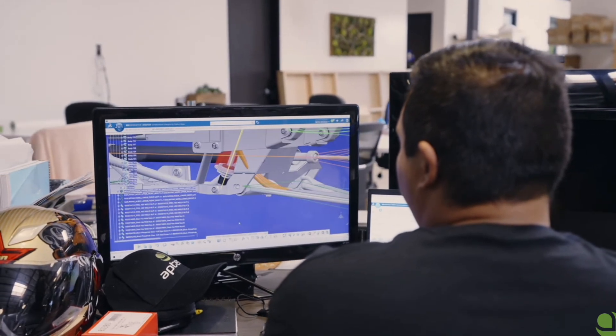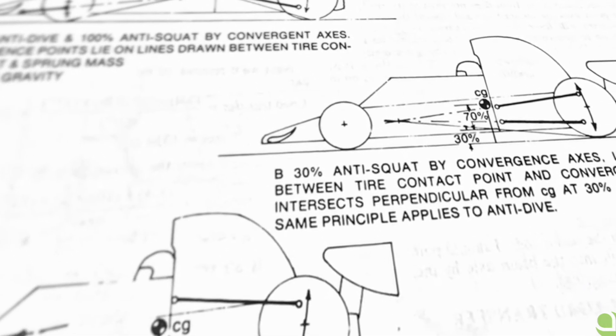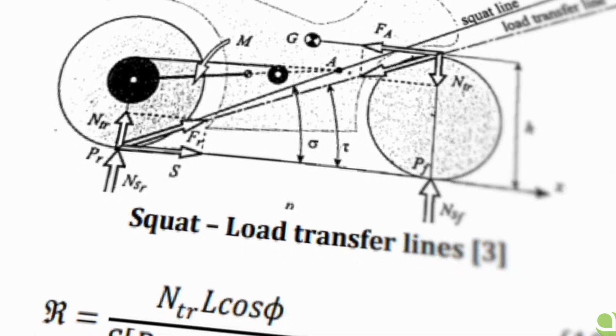You get a very normal vehicle response, something you'd be familiar with in any other vehicle. For the average consumer, if you go over a bump and the car jumps up really aggressively or you don't feel it at all, those are things people will perceive — maybe not knowing exactly how to explain that. Spring rates, damping rates, and even air pressure in the tires affect those things greatly. One of the biggest things is making sure the ride rates are as someone would expect in a vehicle of that weight.